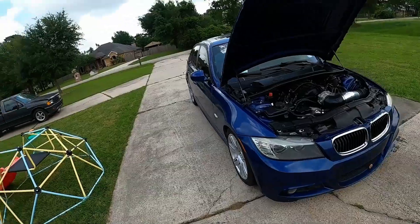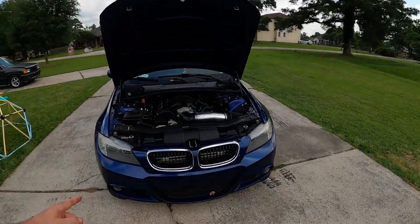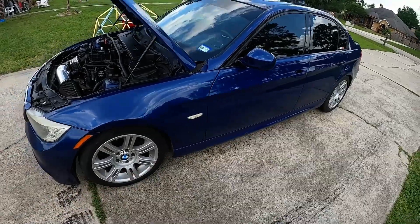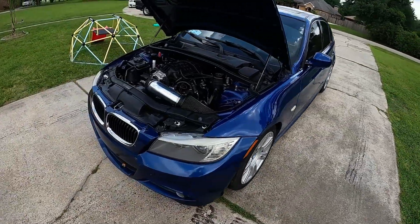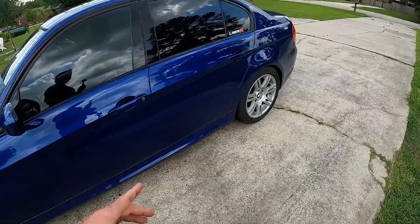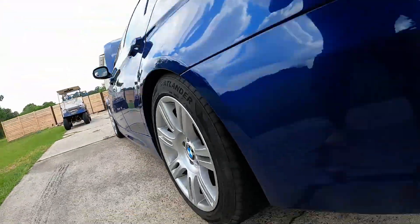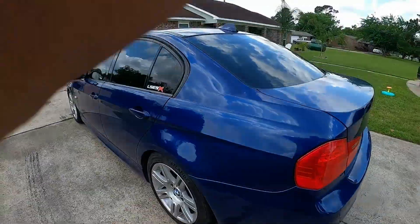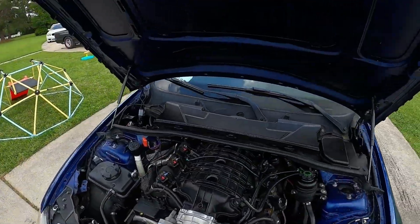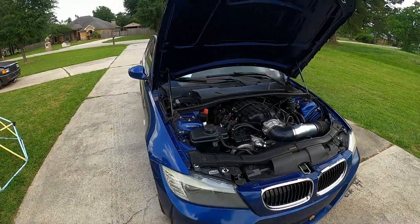What you're going to see us do next is pull the 6L80E out and put a 10-speed in. One of the really nice things about using this factory GM ECU is that it can control 8-speed and 10-speed GM automatics. We got a 10-speed from Caesar out of a Camaro. We're going to put together the wiring needed, swap it out, go through all of that, and show you what's involved. We'll also probably go ahead and change out the rear gear — right now this is a 3.46 or 3.35 rear end — probably going to put a 3.08 in it with the 10-speed and have a nice highway cruiser.